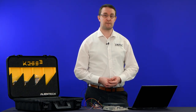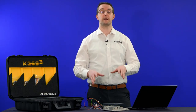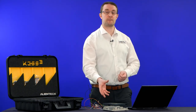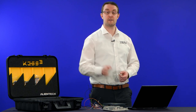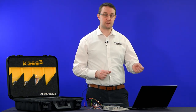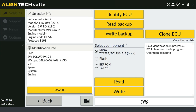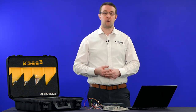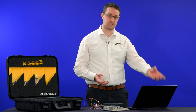We've successfully identified the ECU. It's advisable to save the ID at this point so you have it on record. We'll save it as EDC17C74_ID. Whenever saving a file, use something relevant to that ECU — a customer license plate, registration number, or chassis number — something unique. The last thing you want is ten files all named EDC17C74 with no idea which car they belong to. If you ever need to submit it for a driver request to the Vizu technical team, you've got it saved and ready without repeating the whole process.